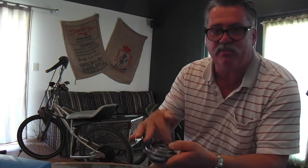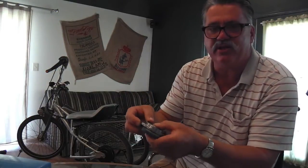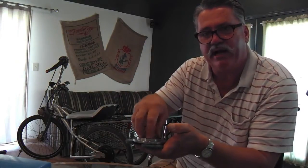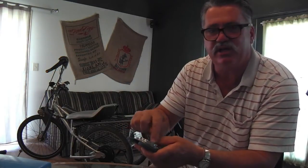So that wasn't the weak link on these geared hub motors by BMC. I think it's pretty well known now, at least to me, that the weak link is the clutch mechanism that resides in this little slot here. Now, you undoubtedly can imagine that that's where a caged bearing goes, and sure enough, it did. But in that caging material, which is only plastic, there were breaks in it.